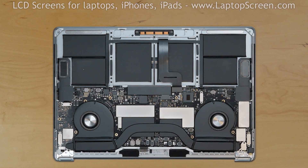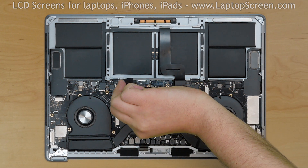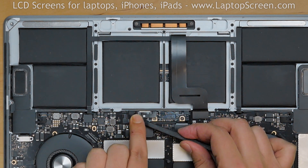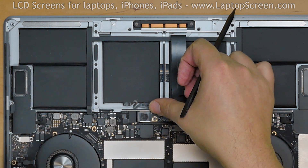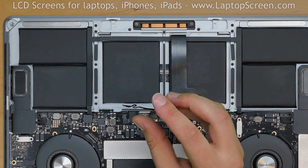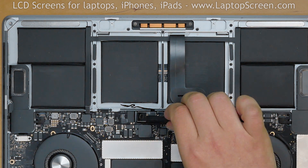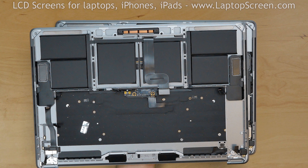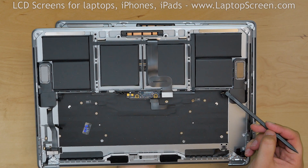At this point, it's a good idea to disconnect the battery. Lift the black plastic cover over the battery control circuit. Using a plastic spudger, open the keyboard backlight connector and carefully pry off the flex cable. Using a Torx 5 screwdriver, unscrew the wide cap screw securing the main power leads and pry up the power leads away from the battery control circuit. You can use the replacement part as a reference for all the connectors that need to be undone: the keyboard, the touchpad, the speakers, and the USB jacks.